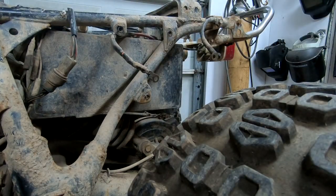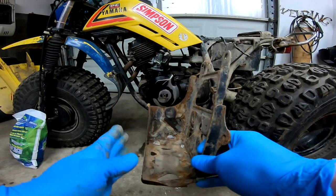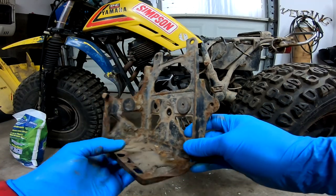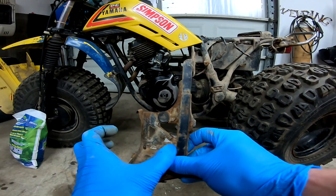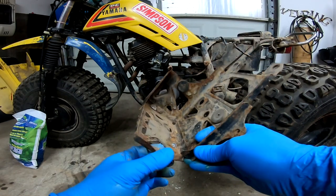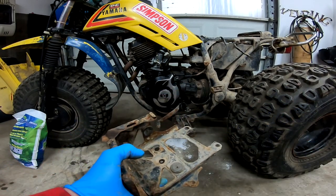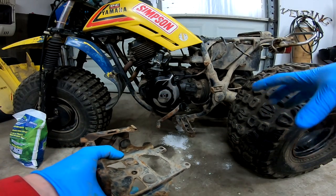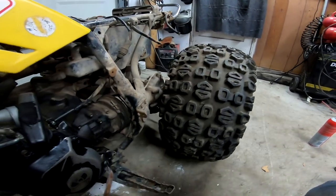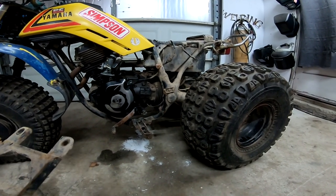Here is what this bracket looks like. The battery that was in here had a chunk missing out of it. Also, the battery I purchased is slightly wider than the previous one — the last one was 3-3/8 inches wide and the one I purchased is 3-1/2 inches wide, so one more eighth. Hopefully that won't make a difference once I fix this. We have a tube in this tire, so the tube or the tire sits a little bit taller and less wide, because if it sits wide with less air in it, that extra eighth is going to hinder us slightly.